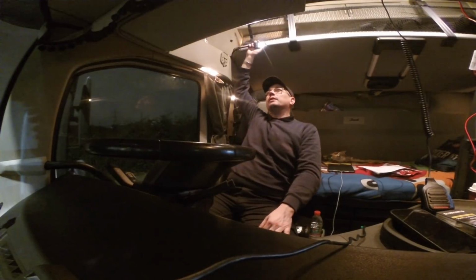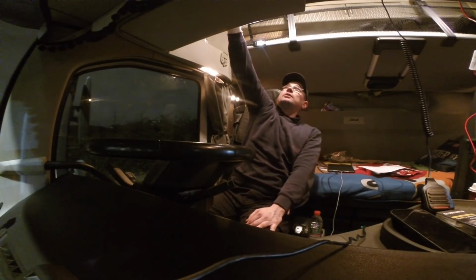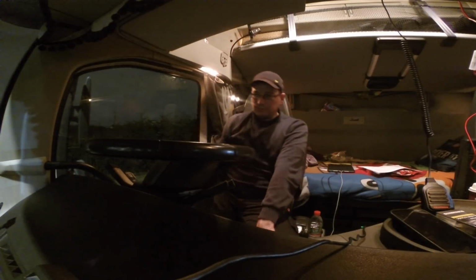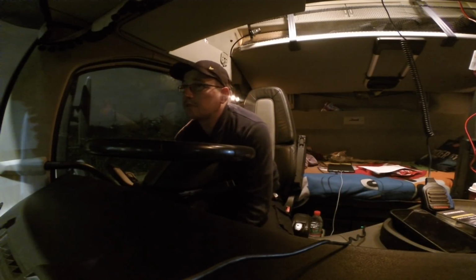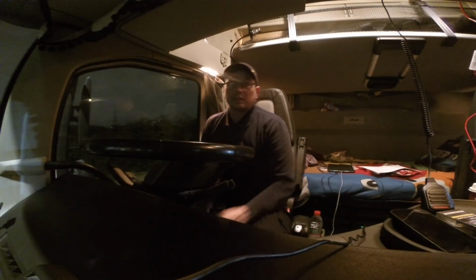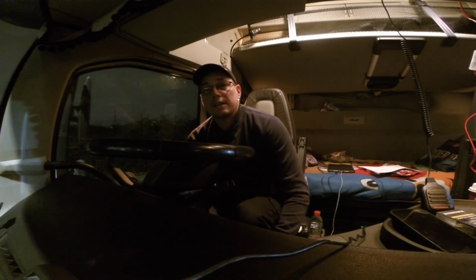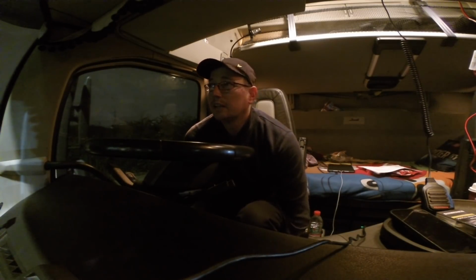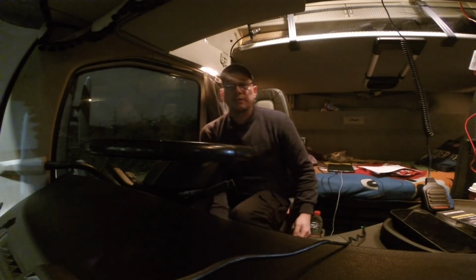Well, actually, technically, what you're supposed to do is, if I go in the menu, keep going down to driver entry, down to end country, and end it in the UK. That's technically what you're supposed to do. But I've never had any problems. I've never been pulled up about not doing that. Some do that, like if they leave the card in, some drivers don't leave the card in. It's not really an issue, I don't think. No company I've worked at has ever said anything about leaving my card in overnight, and I've usually just put it on rest. I've not done an end country or a begin country. I mean, unless the truck was teleported somewhere in the morning, the begin country is going to be exactly the same because the truck's not left the spot.